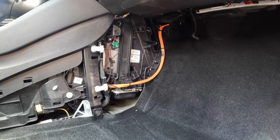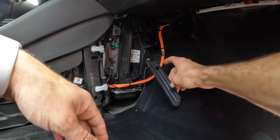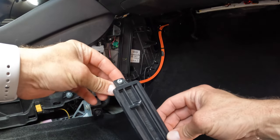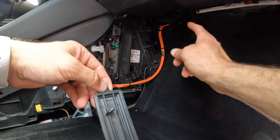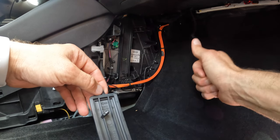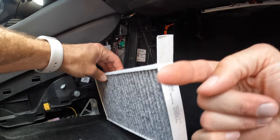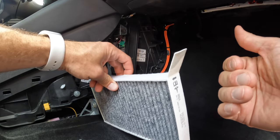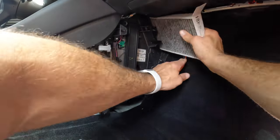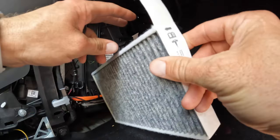I just got done running the AC on max for about four or five minutes. A quick tip: when you put this door back on up here, make sure the groove on the bottom clips in on the bottom, and secure the screw back up to ensure the door doesn't come off when the fan starts. The evaporator system is now dry, so let's put the air filters back in. Make sure the arrow is aiming in the correct direction when you place it in, and this flap goes at the bottom so the next time you remove them you lift it here and raise it up. The next one is the same but for the top.